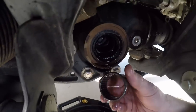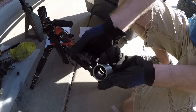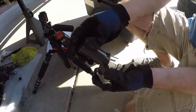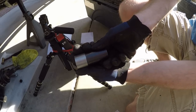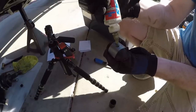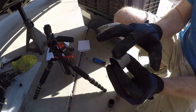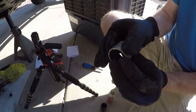And it's out — the needle bearing. Surprise: it's been grinding for a few thousand miles but it still looks okay. Here's the East Coast Gear Supply bushing. We're using a socket to drive it in — find one that fits real snugly. There's a bushing end and a flat end, and you're going to drive it in with the flat end facing out so you don't damage the inner bushing material. Add some assembly lube to hopefully make it slide in a little easier.